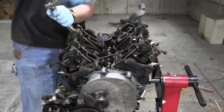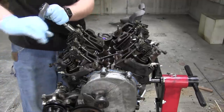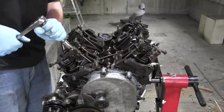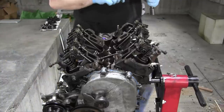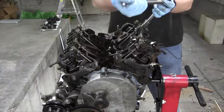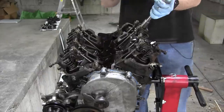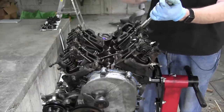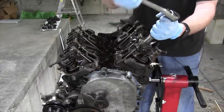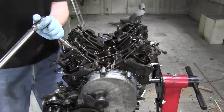Each one of these, once I get it snug, torques down to 32 pound-feet. Which is roughly half what the engine can put out. I think that's actually true. But it'll be more once I get my two-barrel carburetor on there. It'll be pushing out at least 20 more, 10 more, I don't know. I don't know what kind of power gains I'm gonna see from this. I'm just doing it for fun. All right, got the torque wrench set to 32 pound-feet.